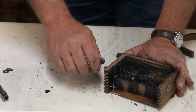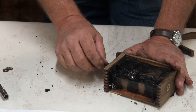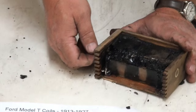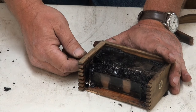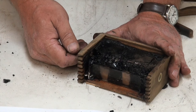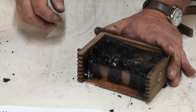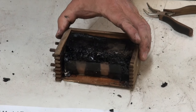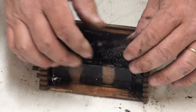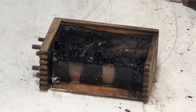So that's why it's important when you're removing and installing the nuts that you don't start twisting the bolt. These are little carriage bolts, and they fit into that wood. And originally they never turned in there because they are carriage bolts. But if somebody's over cranked them and stripped that area of that wood out, sometimes you'll find one that the connection has been broken. So it's just a resolder. Simple repair.